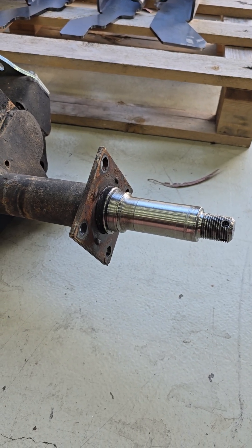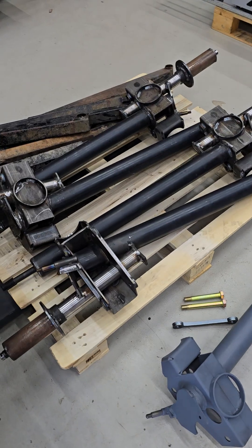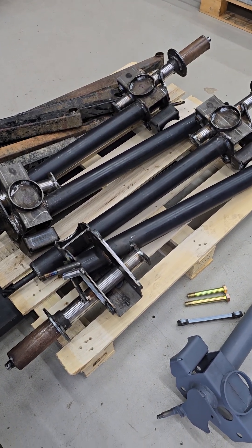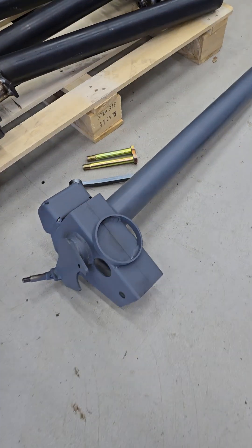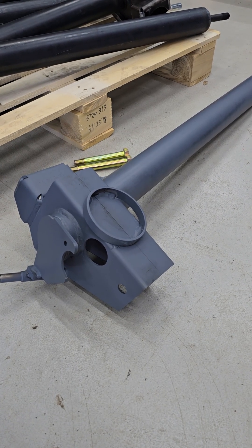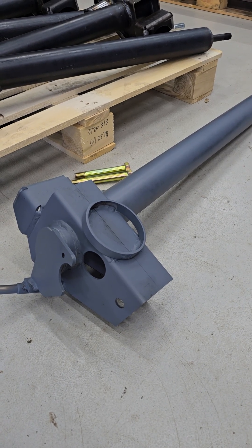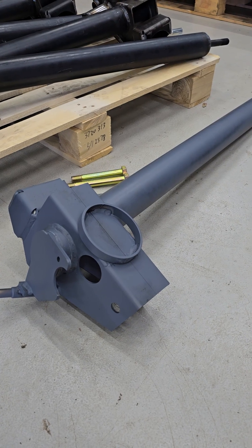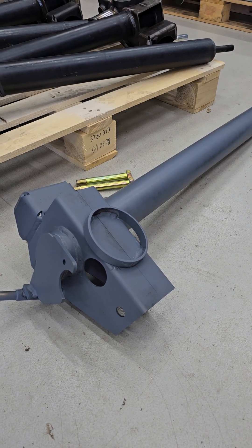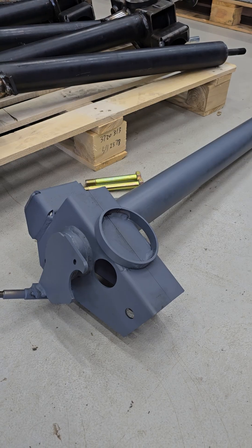I've got a van here that's just experienced that. We've got quite a few vans here at the moment for upgrade, so I'll have a look at perhaps a couple of these axles that are about to go out for powder coat, and I'll show you how we receive our asymmetric arms from TRAC. TRAC supply us bare asymmetric arms and we request them like this because it means we can keep them in stock and quite quickly install the axles, weld them in, get them powder coated and sent out — as opposed to having to wait, because sometimes TRAC might not have the offset we want, and there's freight as well, which can take another week. So we buy them like this, install them in a fixture, weld the axles in at the required offset.